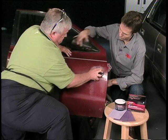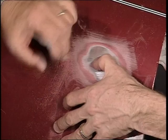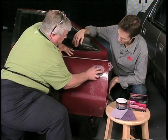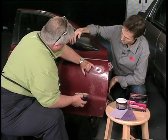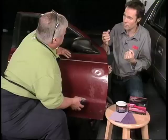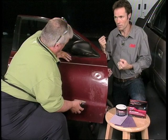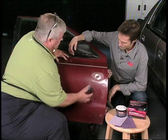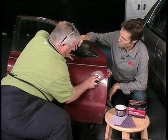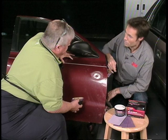So there's four coats that we've just gone through, and it's great because that really highlights the area that needs to be filled. You'll see as you're going, you maintain your dent in, you work around the outside where you can land your filler back in all the way around. Now, how much are you going to sand back — you're down to the bare metal, do you need to get a larger diameter? Yes, you carry it on out, about an inch to two inches around the diameter where you can work your filler inside the area. And does that mean the filler has something to bond to — you want the filler to bond to the metal, not to the paint itself? You'll get that mechanical bond. Sand scratches give you the bite — it gives you a mechanical bond. And you have to kind of get into the middle part and get that down to metal as well.